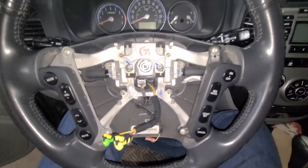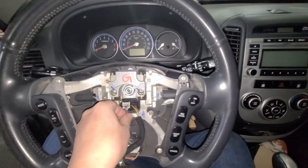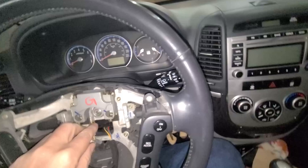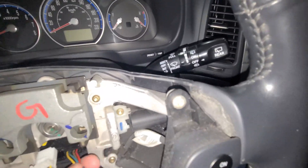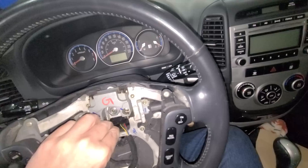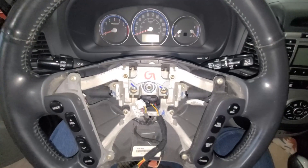With better lighting now, I'm going to disconnect these connectors. I'll separate this plastic clip and pull it out, then pull these out as well — that's one out. The second one will slide through the hole when the steering wheel comes out, so I'll just pull it through. Now I'm going to remove this bolt with an impact — it's a 22 millimeter.